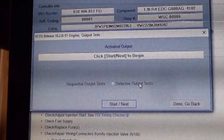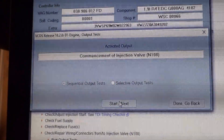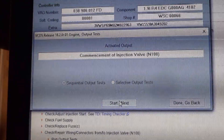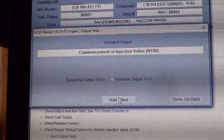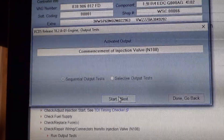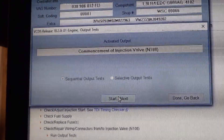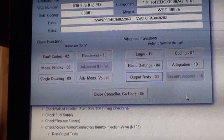We'll do the output test and you should hear the same tone change. It turns the N108 on and then off, then on and then off, so you can hear that the timing is working. What's happening is the computer's controlling the timing, then it goes to base timing, then the computer's controlling the timing, then base timing again. That's how it should behave.